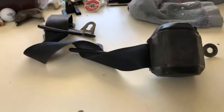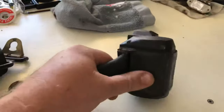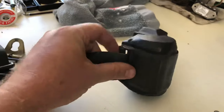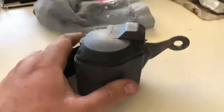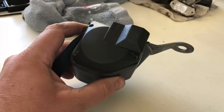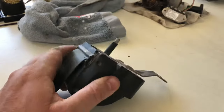So I've got this seat belt here and it just will not release — I can't get any more length out of it. It starts to move and then just locks up. It's because I've taken it out of the car and had it sitting around for a while. What happens is the belt goes in too far and then won't release back. What I'm going to do is take the outside cover off and release the locking mechanism so that I can wind the belt back out and set it up in the car.